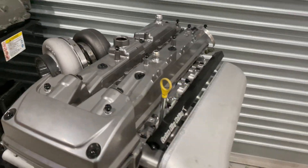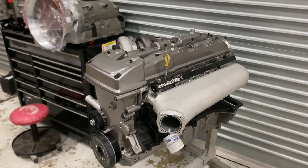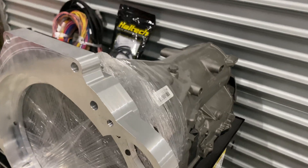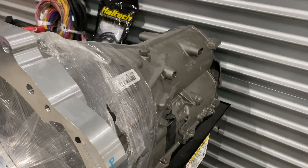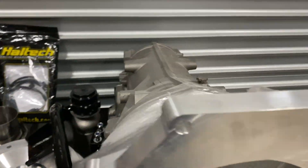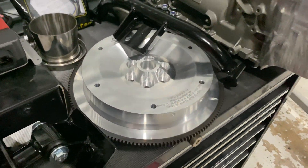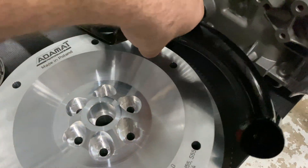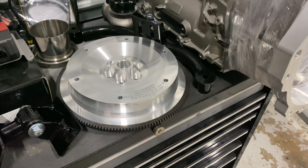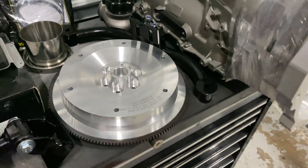That motor is already done - there is another video previously where we buttoned it up which explained everything we put into it. Next is the 8HP. It is an 8HP45 out of a BMW. It's made up with an Atomat adapter - a billet piece that's been machined. That's the Atomat, that's actually the flexplate if you want to call it that, that's the adapter, so that your torque converter will fit and work.